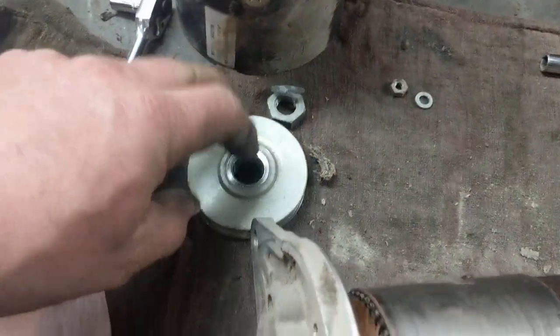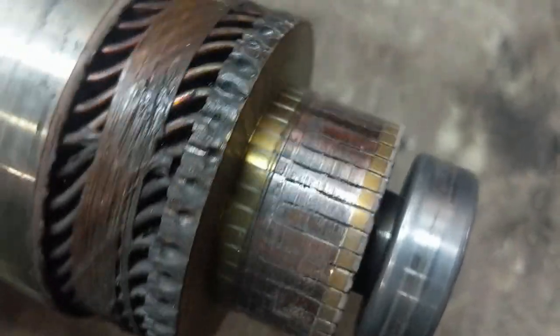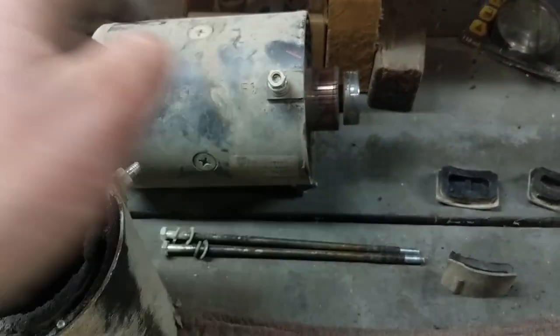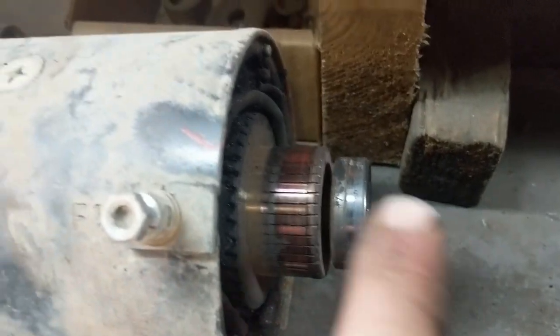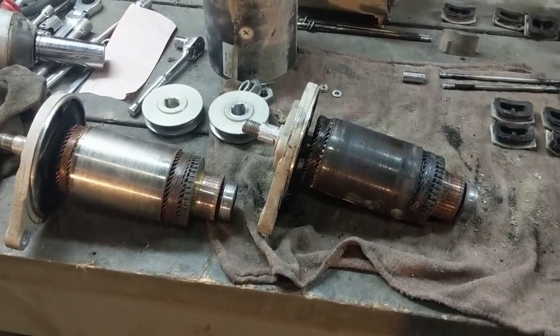Alright, I've got this a little more apart — pulled the commutator out of the housing, knocked off the pulley. You can see it better now; that commutator is pretty much finished. I'm going to take apart the other motor, salvage the commutator and bracket piece since they're attached together, then use 400 grit sandpaper to give it a buff and a polish. Then I'll swap the brushes over and put this back together.